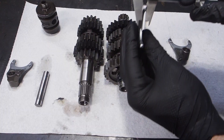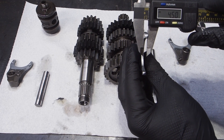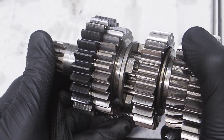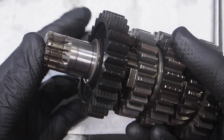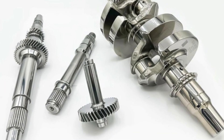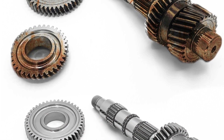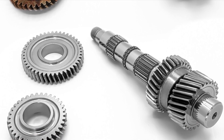Next, we'll take out the transmission. We've got the shift fork pins, then move the shift forks out of the way of the shift drum. Take pictures when you're doing this — it'll help on the install. The shift drum will then pop right out, and you can remove the shift forks after that. With the engine lifted up on blocks, use two hands to push the transmission up and take it out as a group. I've also gone through an extensive inspection process of the transmission over on my channel — checking the thickness of the shift fork ears, the gap where the shift forks go, and making sure there are no chunks or notches out of the transmission gears. With this build, Millennium Technologies is going to take it a step further with their isotropic micropolishing — basically reduces friction, increases durability, and reduces heat in your engine so it can perform at max capacity for longer duration periods.